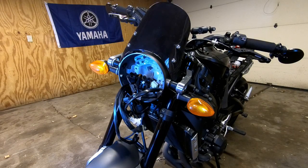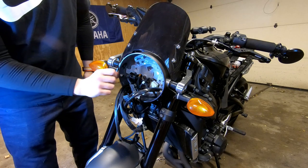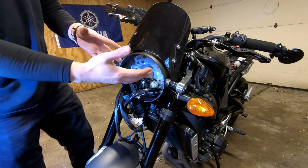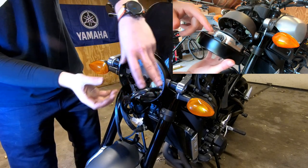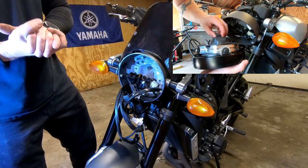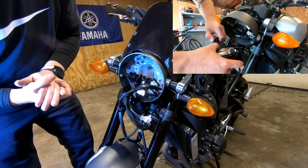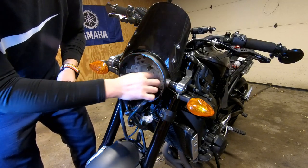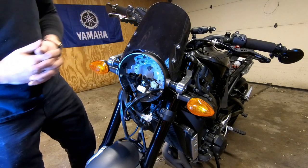Apparently my GoPro wasn't recording or wasn't working. So basically what I've done is I removed the headlight portion from the headlight housing — it's two fasteners, one on each side, they're four millimeter. Once you take that off, tilt the headlight up like this. There's a lip here, and the headlight portion will come loose, giving you the headlight housing. I've taken all the wires loose — they were all wrapped up here, which would have been nice to show you guys. Everything just unplugs and comes loose. You'll have a couple of trim trees — be careful, it's plastic. Let's move on to removing the headlight housing.